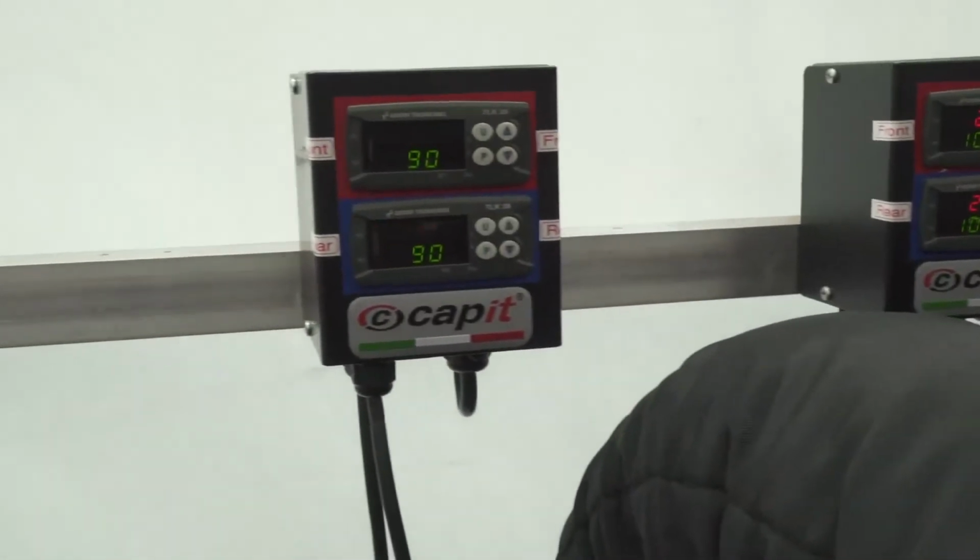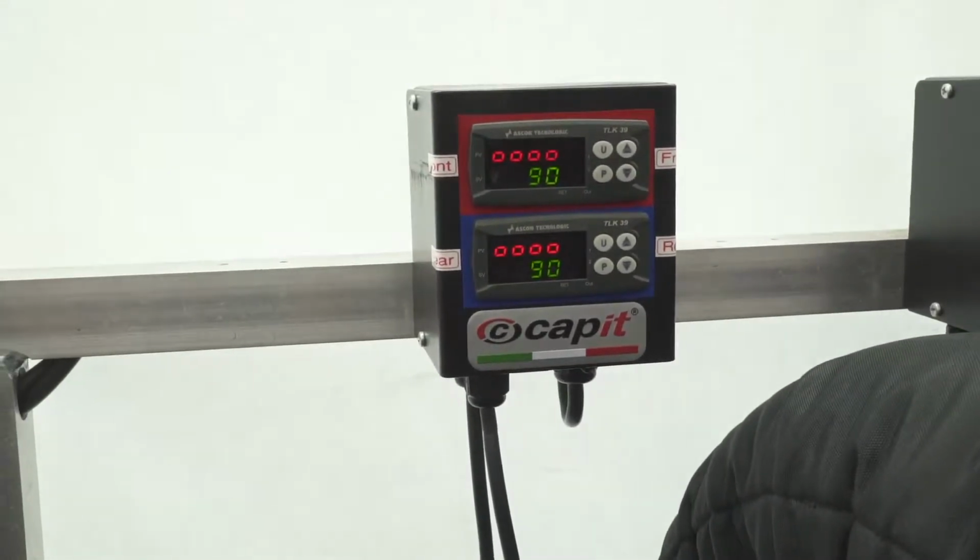All of the tyres that we race with get heated before they go out, so the different condition tyres get heated to a different temperature and a different time, but I do know that the slick tyre, the one that we use in dry conditions, actually gets heated to 100 degrees. So the rim gets really hot, the tyre gets really hot, which means that even when I go out for the session, if I'm a bit slower and the tyre cools down a bit, the rim's still really hot, so that it keeps the temperature in the tyre basically.